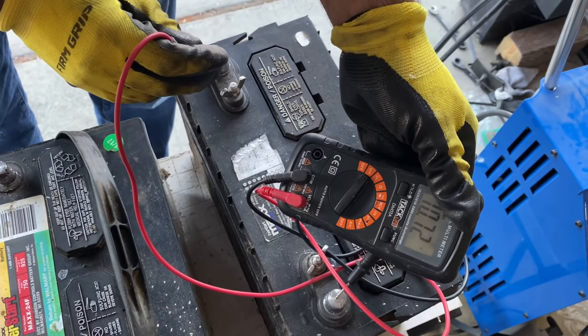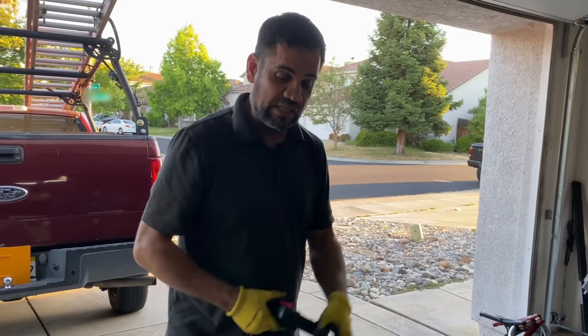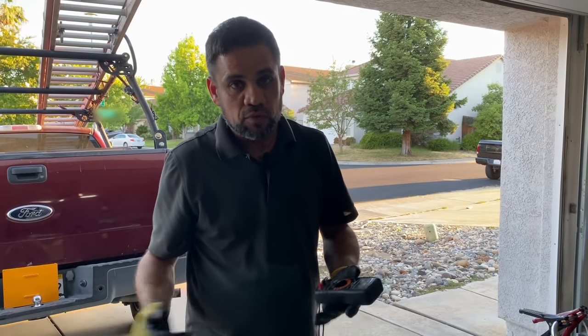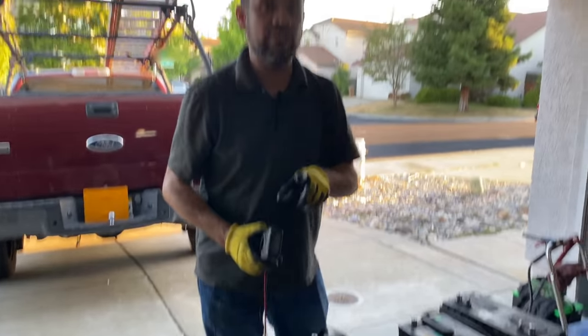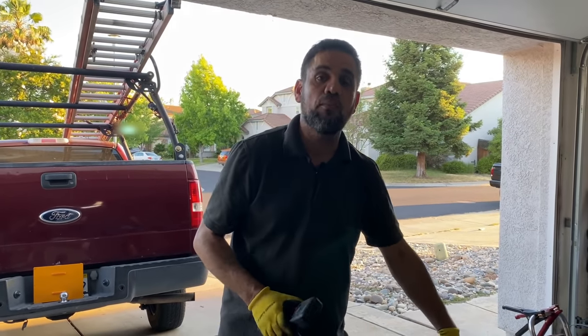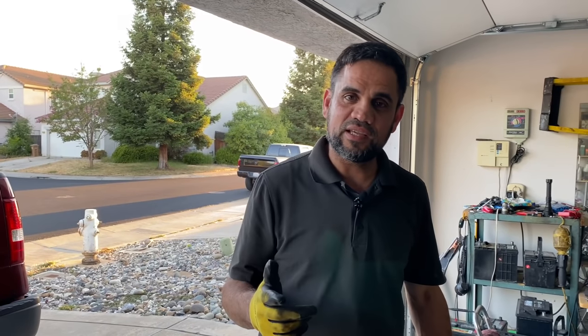This deep cycle one is probably not going to work — not every battery is going to charge. Remember, these batteries were sitting for a long time. If it was your car battery that was starting up slow, most likely it would have been 100% because the battery was still good. Anytime your battery starts slow, take it out and do the same procedure — it's almost guaranteed to work because your battery is probably at 75 or 80% and will go almost to 100%. These batteries were completely dead to begin with. Let me know in the comments if you tried this at home and how it worked, and make sure you like and subscribe — thank you!